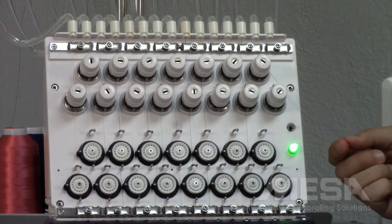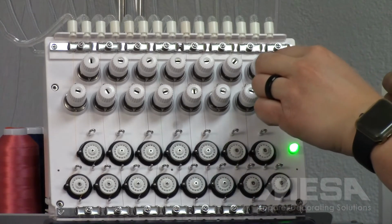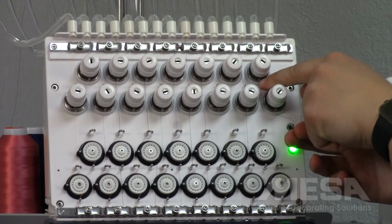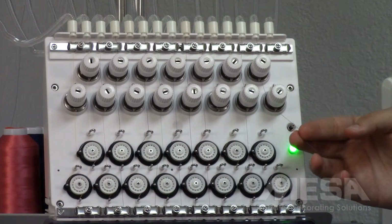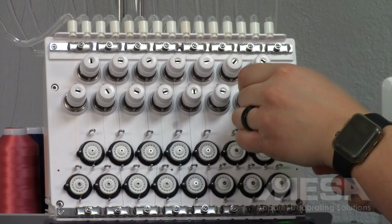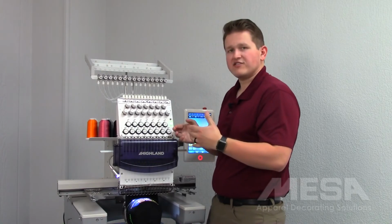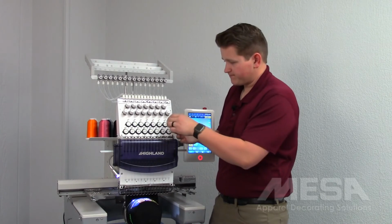Just like our pre-tension knobs, our main tension knobs are threaded going around on the right side, in between those two metal discs, going half a time around. Then we come to these small posts, which are right underneath your main tension knobs. They're kind of hidden, which makes them easy to miss, but we always want to make sure to bring this thread over the top and down on the left side of that post. Be sure to always pay attention to that, as you don't want to miss it and lead to a poor thread path on your machine.